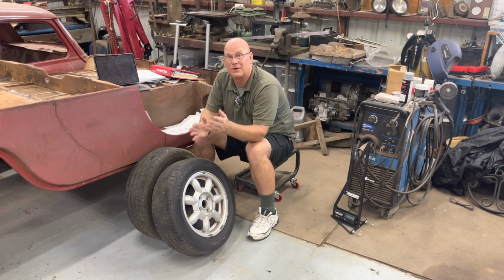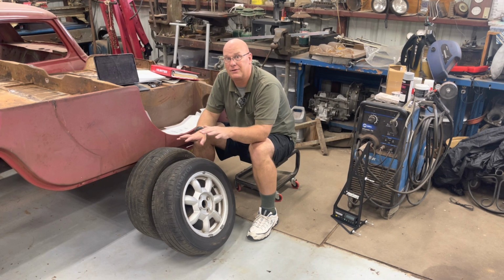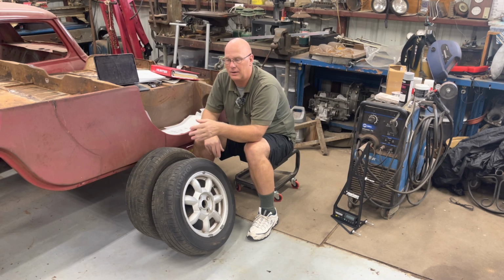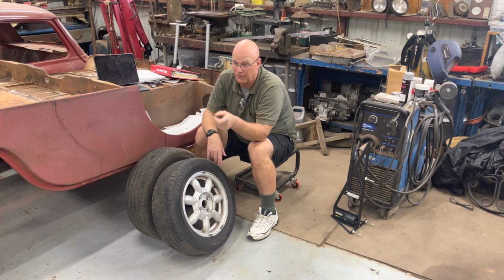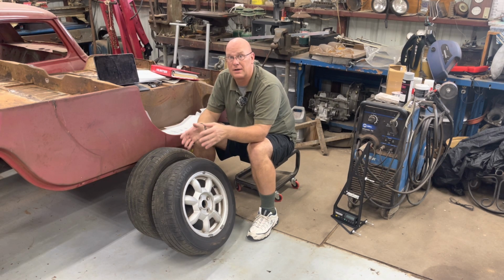Any car you go in for alignment, if it's been more than 20 or 30,000 miles since all the suspension and steering parts have been replaced, they're going to find something wrong. Just letting you know. If you're doing it yourself, you're going to find, I can't get this as tight as I want. I replaced all the suspension parts on the Miata. I can get it exactly where I want. The Porsche, I haven't replaced the parts yet, and I cannot get the camber I want or the toe I want in the rear because the parts are worn.